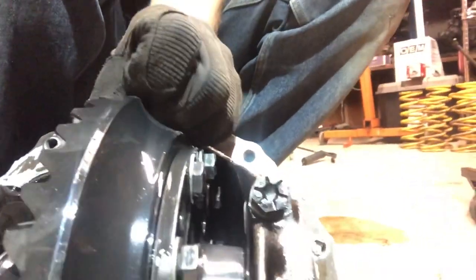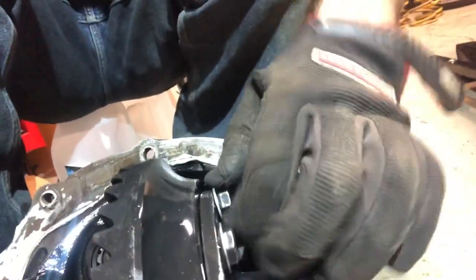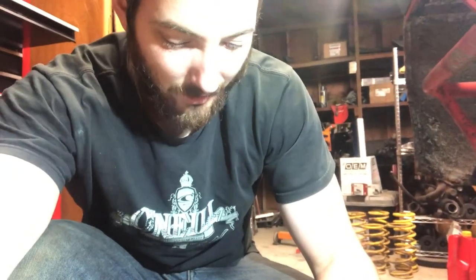All these bolts are backing off - the ring gear is literally floating on the spool. None of them are even finger tight. None have broken off yet and none came out, thankfully. The ring gear looks okay - I rotated it all the way around and the teeth look fine. The fluid looked really clean. I still need to tear it apart and check the pinion gear and bearings. Really lucky on this one. Kind of a coincidence - I'm teaching you guys how to build a rear end tonight and then I pull mine out and find it's failed from user error: bolts too long, bottoming out.